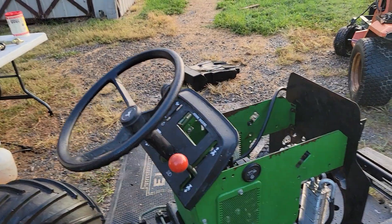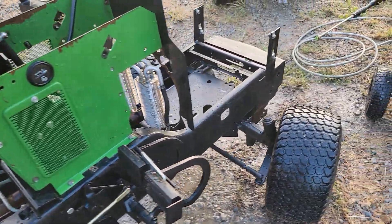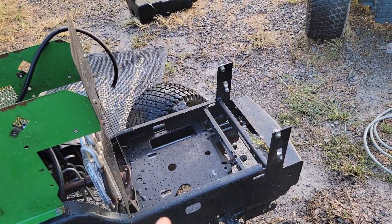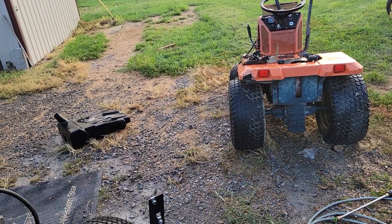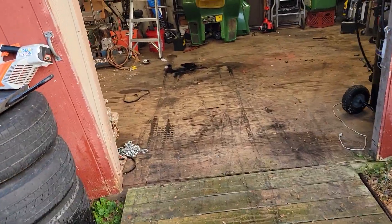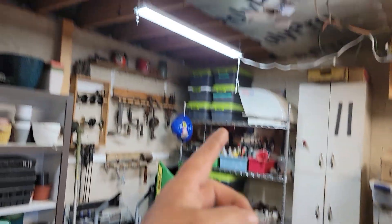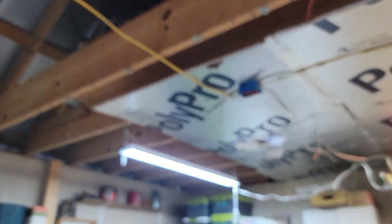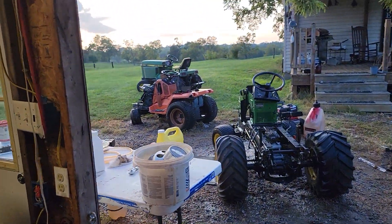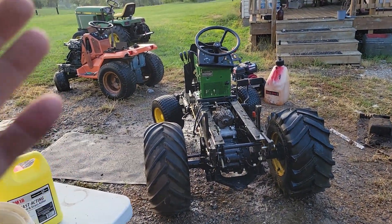Other than that, it is about ready to go back together. I did try to pick up the engine last night and swap it over, but turns out I am not strong enough to pick up that motor by myself safely. So what I'm probably going to do is back this back up in here, cock it kind of angled, and pull a chain off of this using a chain hoist. That's a 2x12, so it should hold. The engine is probably only 175 or 200 pounds at best, and I know I'm going to have to go up and down with it while I'm messing with it.